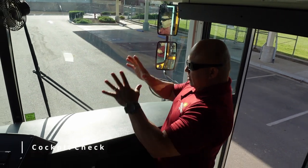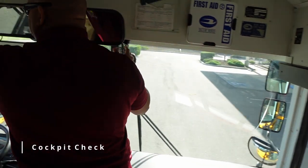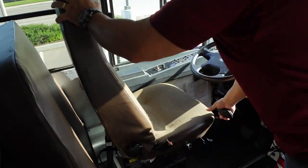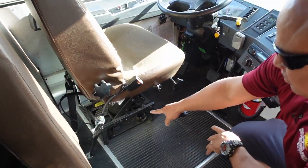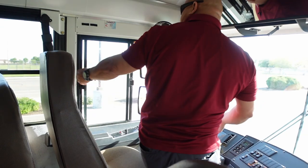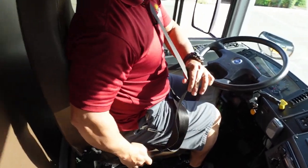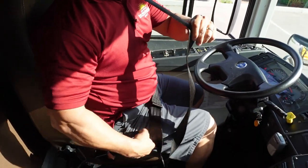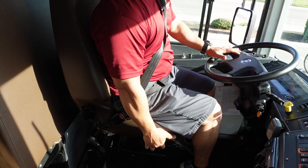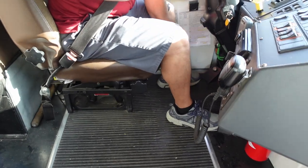Since I'm done with all my emergency equipment, I'm going to move on to the inside. My inside flag is secure, my fans are secure, my visor is secure. Checking my seat, making sure it's secure with no loose screws and my bracket is secured to the floor. Next I'm going to check my seat belt, making sure it pulls out freely with no frays or damage, that it locks in place and also unlocks. Since this is a type 1 bus, the seat should go up and down, forward and backward, and lock in place.